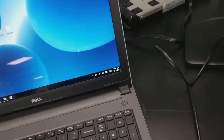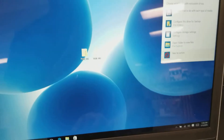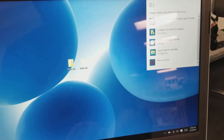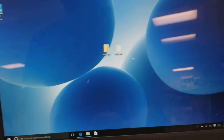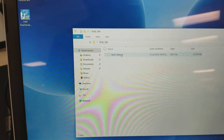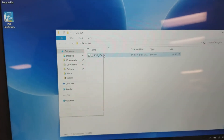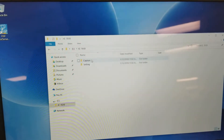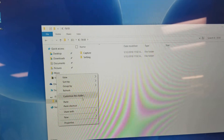Take it over to your computer, go ahead and plug it in, and we're going to copy our files over to the flash drive. Once the download is done, it's going to be a zip — you're going to want to unzip that, and then you'll get a folder. In that folder you'll have a 7610104.dat. We're going to copy that and paste it into the root 7610 folder, right on your USB flash drive.